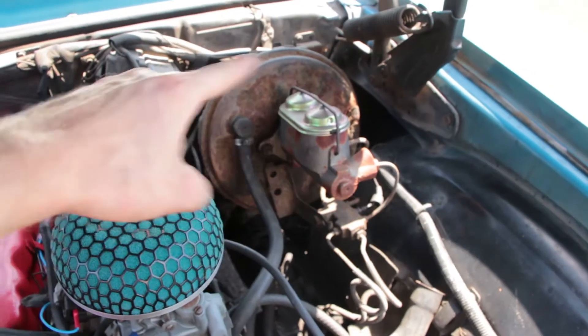So what are we doing today? Since we're doing a manual swap, I just got the automatic transmission brake pedal taken out and put the manual transmission brake pedal in along with the clutch pedal. The clutch pedal and brake pedal ride on the same pin so you had to do them both at the same time. The big automatic pedal didn't leave room for the clutch pedal, so you had to put in a manual transmission pedal which is shorter. Now that we're done with that, we're going to start with the brake swap. We're taking the brake booster out first since I already got the brake pedal disconnected from it. We're also going to loosen the engine mounts and transmission mount so we can get the old engine pulled out right away when we get an engine hoist in here, and hopefully plop the new engine right in after.